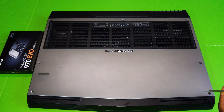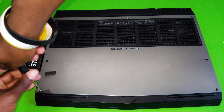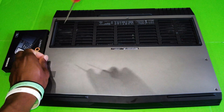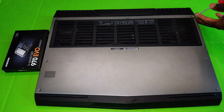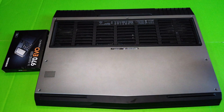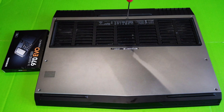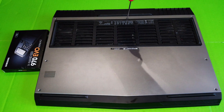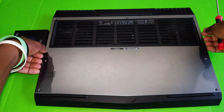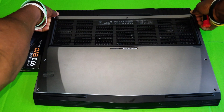Using a screwdriver, I'm going to go ahead and remove the screws from the back. There are seven screws on the back. I just removed six, but the last one on top right here — you actually unscrew it but you don't remove it. There is a clip holding it with the back cover, so you just undo it but leave it there. You can then go ahead and squeeze through the sides.